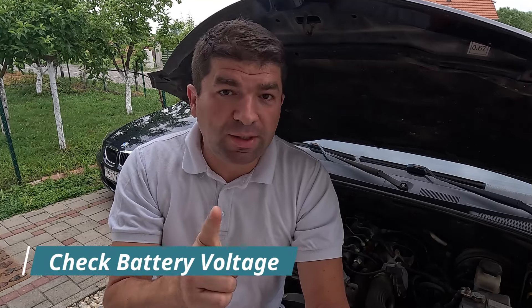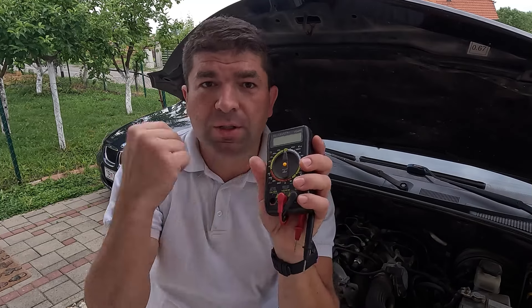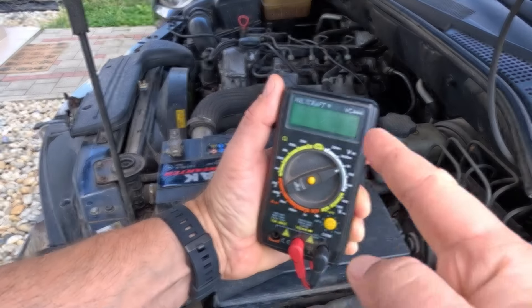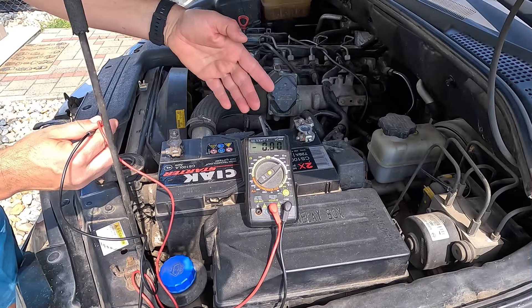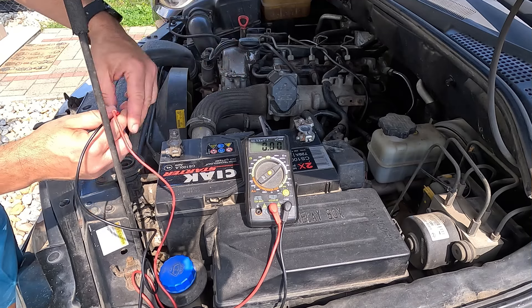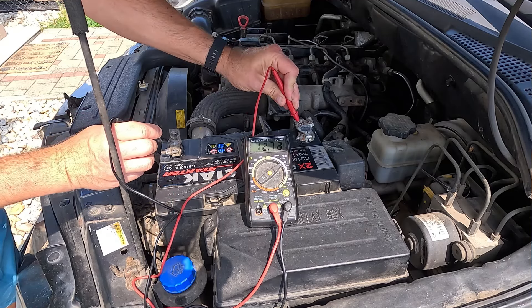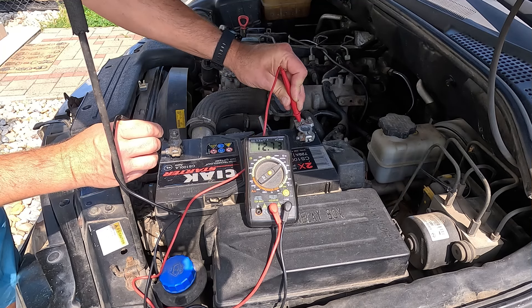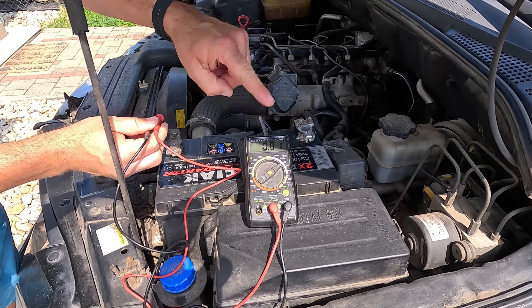Checking the battery just by looking at it will not always do the trick. This is when you'll want to use some tools, among which the multimeter is my favorite and something I'd recommend to every car enthusiast. It can be used to measure all sorts of things, like voltage or resistance, making it crucial for troubleshooting and repairs. In this case, we'll set the rotary knob to voltage, as this is what we want to check. Now, with the car still turned off, connect the tester probes to the battery's positive and negative terminals and check the readings. If the battery is in good condition, you should see approximately 12.5 volts, while anything below 12 volts means there isn't enough charge in the battery.